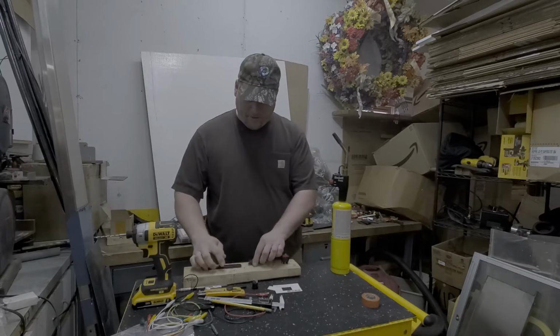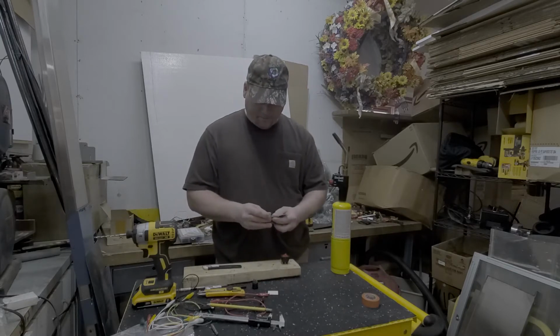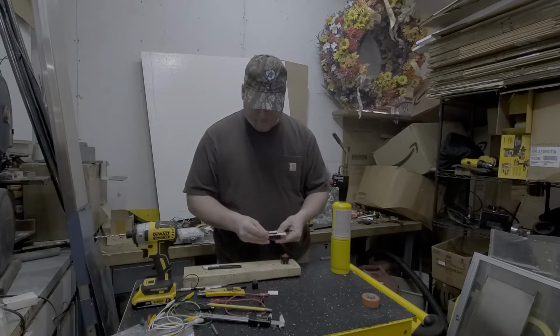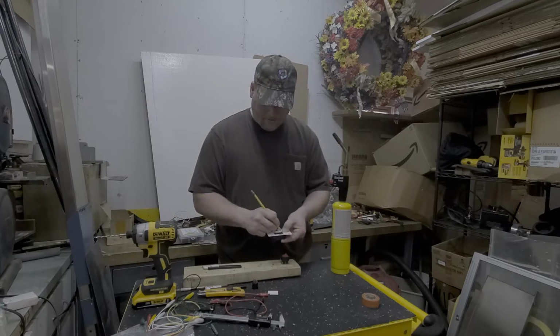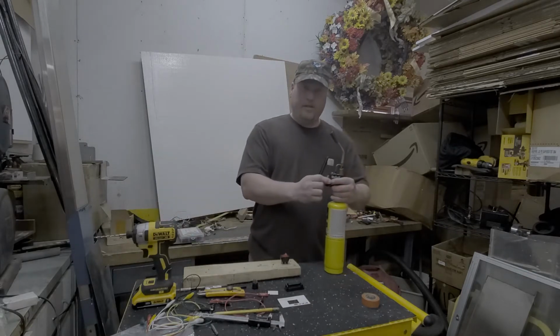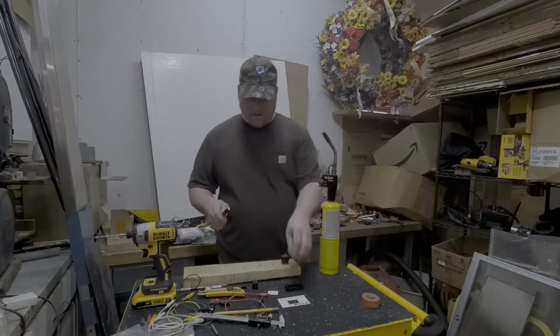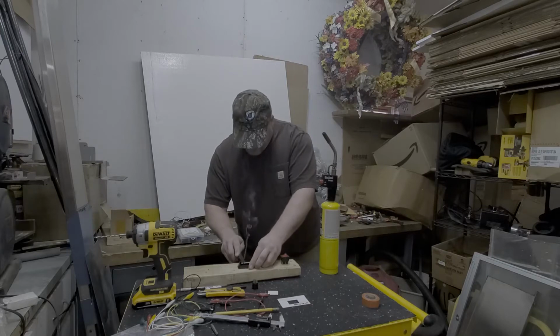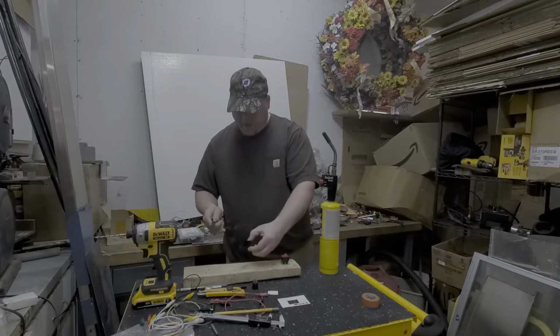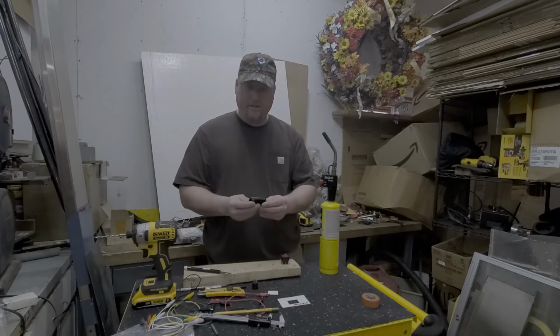So save this good blade for another project. I'm going to show you how we cut this open. We still have our markings from the side, or you can use your template. Then you take your pencil and mark your edges. A torch is helpful, and heat up your razor blade. Get it glowing red hot, then follow your pencil line. It cuts like butter. You usually only get about a half inch per side. So that's the side. I'll show you the marks, how well that cut.